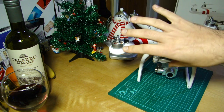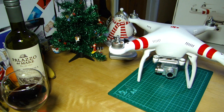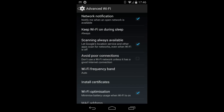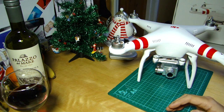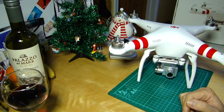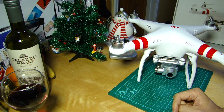Luckily there is a simple switch you can change in settings — it'll look different depending on which phone you've got and which skin of Android. Mine is a bog-standard Nexus phone with plain vanilla Android. If you go into your WiFi settings and look at the options, you'll see a tab called Advanced. In there you'll see a checkbox — on mine it was ticked by default — which tells the phone to drop the connection if it can't find the internet. You want to untick that, or on your version it might be worded differently, but basically you want your phone to ignore whether the internet is at the end of the WiFi connection and stay linked to it.